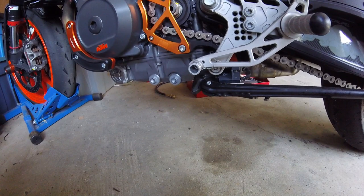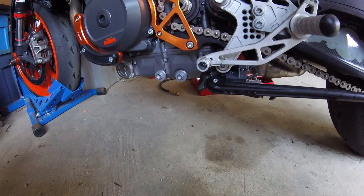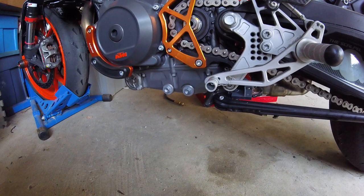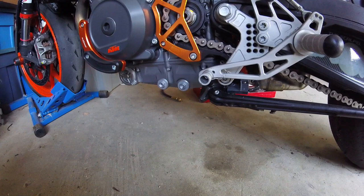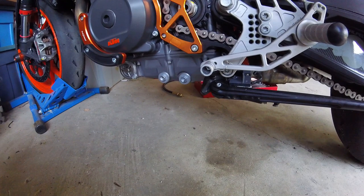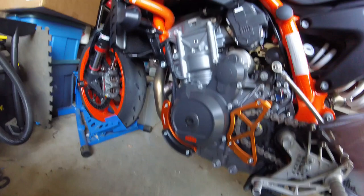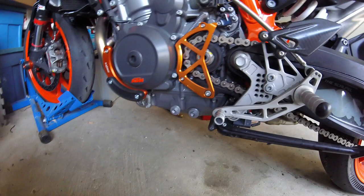I did see what I thought was a big hunk of what looked to be, from the angle and the light on it, a piece of chrome plating that you might see on a gear or something like that. Like I know with Ducatis, some of the rockers would lose their chrome finish. Anyway, turned out to be that anaerobic sealant, so nothing severe going on in terms of the engine department. So no leaks on the cylinder head, which some of them are doing. I thought I might have a bit of a leak behind the countershaft sprocket, but that's not the case. It was just chain lube.